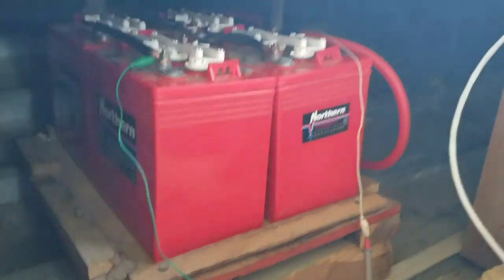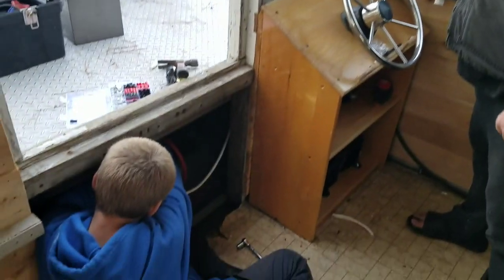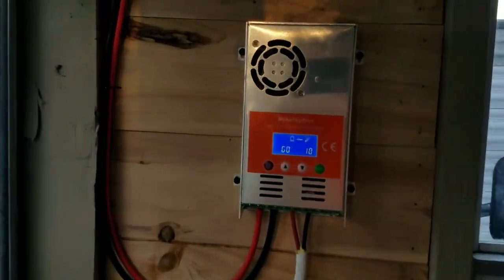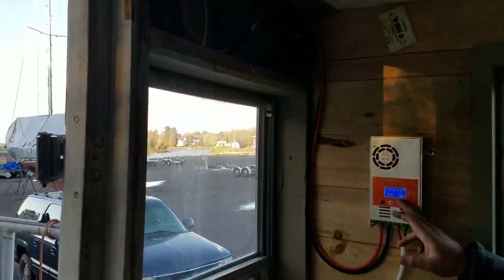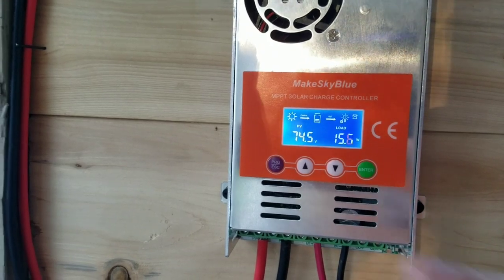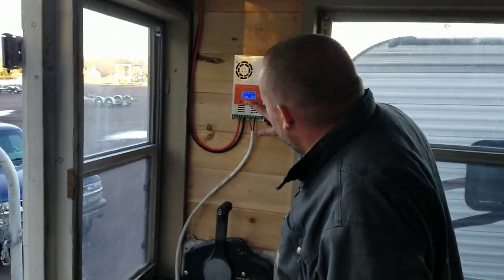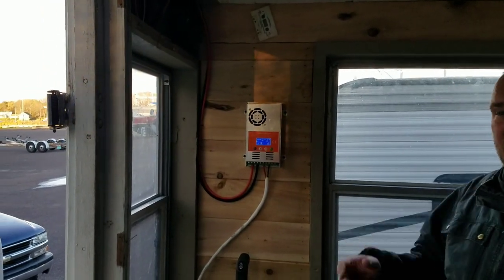I got about half of that, but that's more than yesterday. Okay Mike, what do we have? It's kind of a moment of truth here — we're about to wire this in. Go ahead and throw it on the positive side of that battery bank. This will go live. There you go — 11.8 volts. Once he gets that bolted down, I'm going to throw the charge cables together and we'll get this thing seeing a little something. We just plugged the panels in, and right now, even though no sun's hardly hitting anything, we're getting 15.6 watts of charge. The voltage of the panels combined, running in series, is 75 volts. That is so cool — you're getting charging right now. Free energy. 1.2 amps of charge, like a trickle charge — that's what the sun's coming in at.